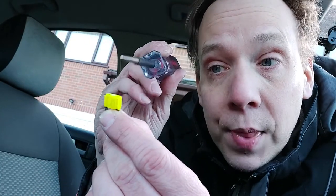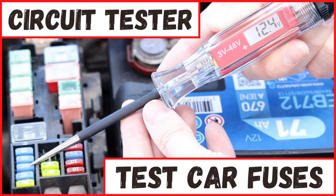In contrast, if your circuit tester lights up when you touch one pin on the fuse but not on the other pin, that means that fuse has blown and you need a new one. And finally, if the circuit tester doesn't light up on either pin - if there's no sign of life at all - that means the fuse isn't getting power. Now that might be for a very simple harmless reason like the ignition hasn't been turned on, or perhaps there's a fault. I made a video a long time ago that explains in more detail how to use this circuit tester - there's a link in the description of this video.